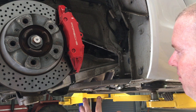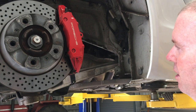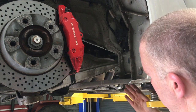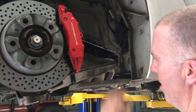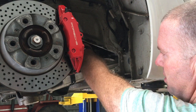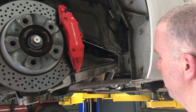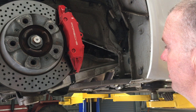Depending on the cylinder, you're always going to come in from the side to remove the plug itself, but to get access to put your hands in, sometimes you put your hands in from the front, and sometimes it's actually the center one which is the hardest, because you've got this little gap to try and put your hands in — especially to get those little torque screws out to remove the coils, and also to get the plugs off. You'll just have to work out what works best for you, but I would suggest removing that trim to give yourself the most room possible.